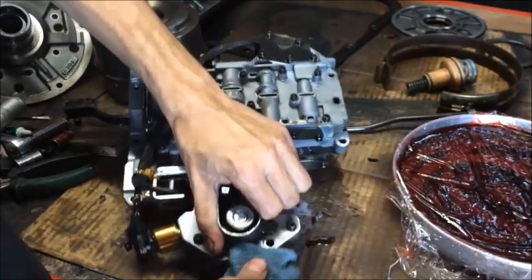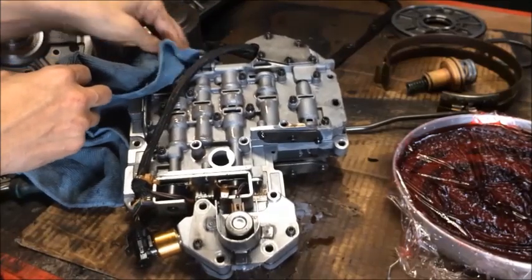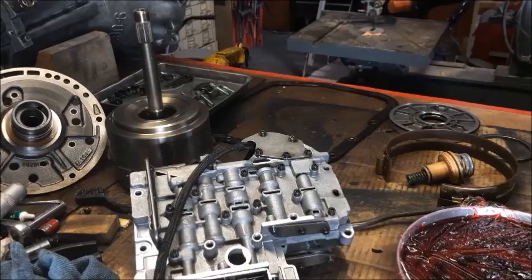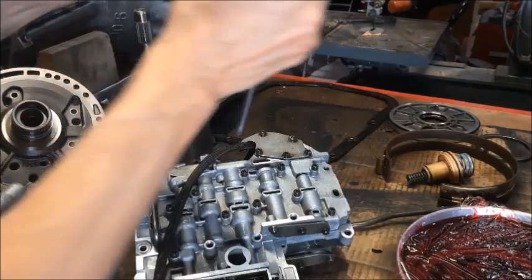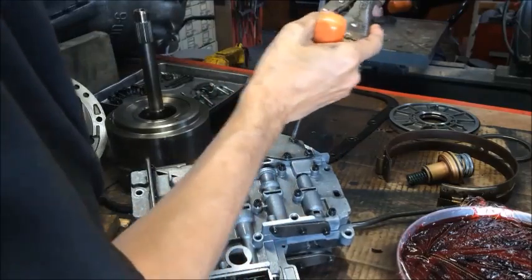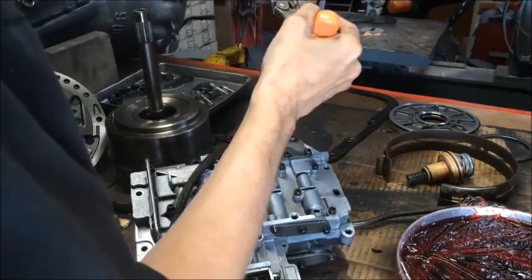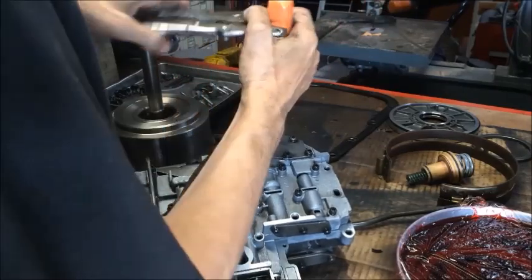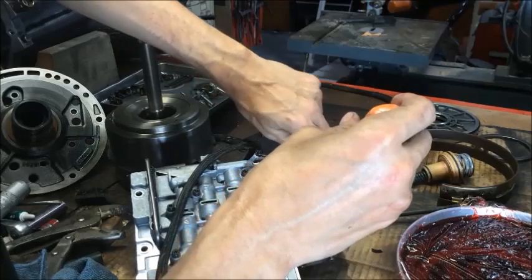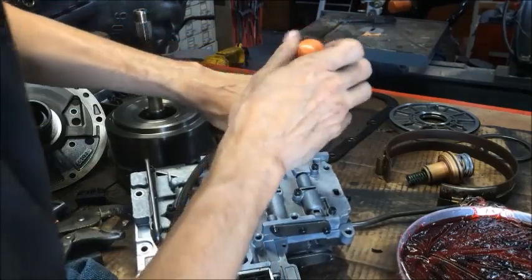You can see there's a gasket in here in this part. Just try and clean off all these surfaces — every little bit's going to help. So if we want to fix the two seals on the accumulator piston, we're going to want to open up this end plate right here. I'm going to use a set of vice grips to give myself a little more leverage and start all five of these screws. After we get them started they should come out without too much issue. I'm going to try to keep track of them and put them back in the same location, just in case one is a different shape from the others.